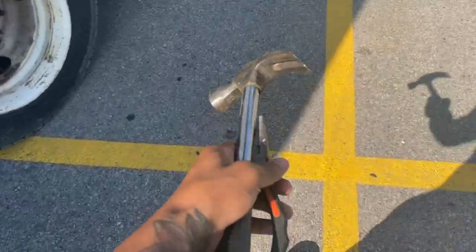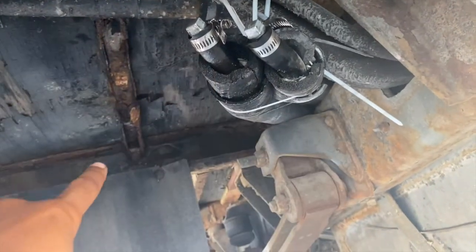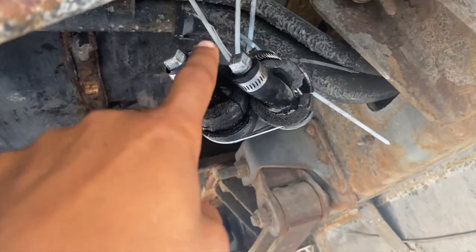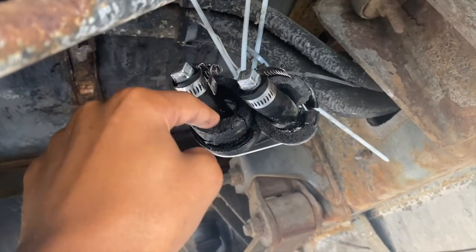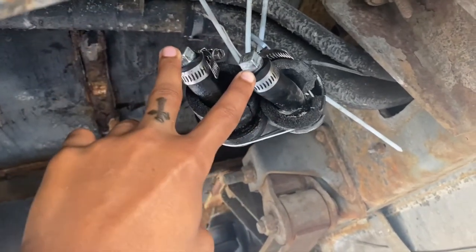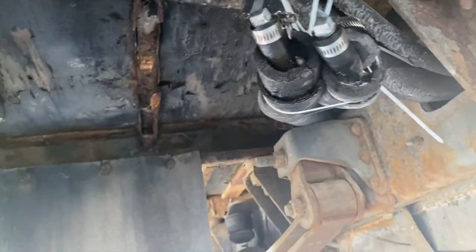Let me crawl underneath here to show you what's happening. We have two heaters that were removed — one in the front, one in the back. When you remove them, you need to cap the hoses so the coolant and antifreeze stays running in the engine. We got three-eighths galvanized plugs — you put them in, then use hose clamps with a flathead to tighten them. That plugs the hoses off so coolant keeps circulating in the system.